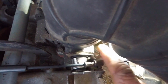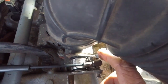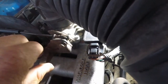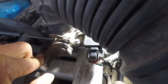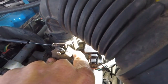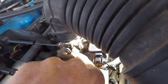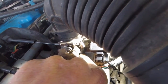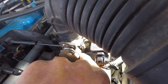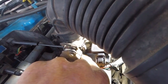You can see right behind there where the hose clamp goes between the spring and that bracket. It's going to create a little shim on there. The trick is to get it on there without the tail end of the hose clamp doubling up — that'll give you too high of an idle. That part can slip down on top of the screw between the screw and the bracket, which caused me a high idle.